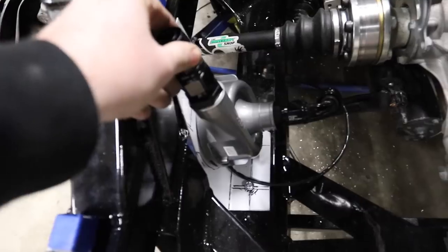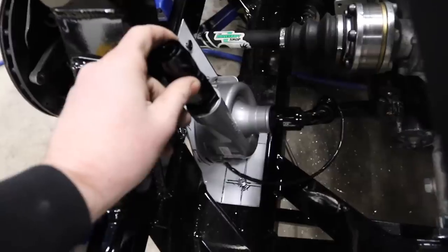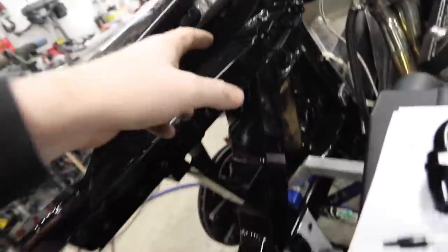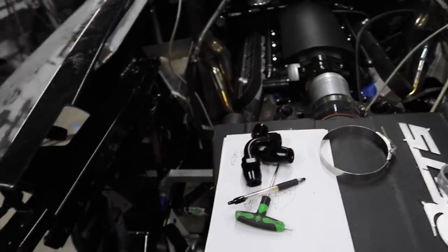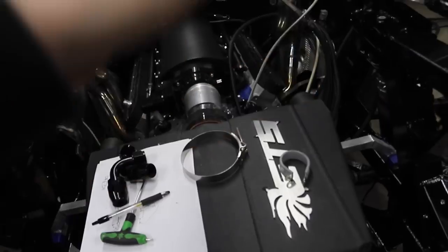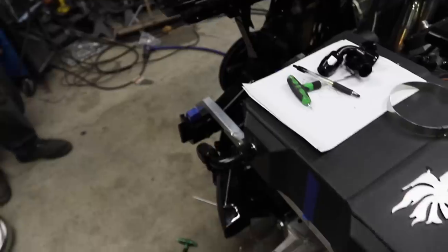I've built a bracket and got everything loosely mounted in here — that'll get painted the same color as the frame. The reservoir comes down into the pump, pumps straight into the heat exchanger, through the core, then to another heat exchanger, through the other core, and back. We were going to do a T system but it was simpler to do it this way. The important thing is it's all even — one heat exchanger, one core, one heat exchanger, one core — so they both get the same amount of cooling. Now I have to make hoses, which takes a long time, but busting them out as fast as I can.